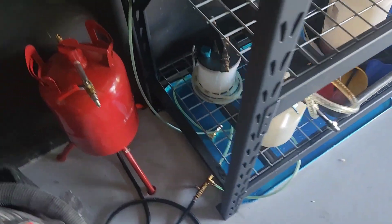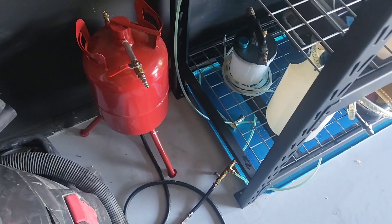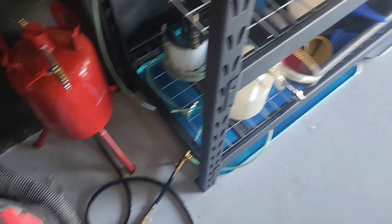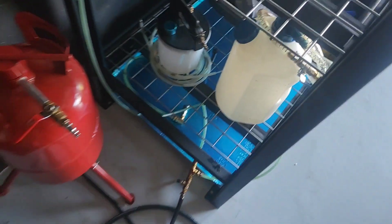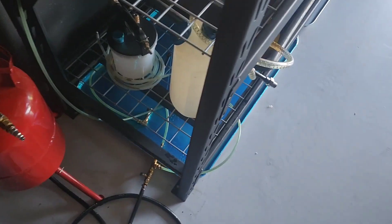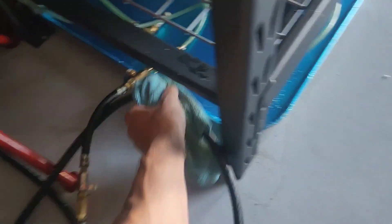Vacuum filling gets all the lines full of fluid, but that's not enough to get the car working again — you also have to pressurize it. Open your valves here, here, and here to pressurize the whole car to 100–120 PSI. I ran it at 120 PSI last time. Once you have it all at 120 PSI, close the valve and undo your disconnects. Make sure the QC valves you put on the car have check valves in them so they don't leak fluid — those connections need to keep the fluid in. I'll put the part numbers for both quick connects in the description.